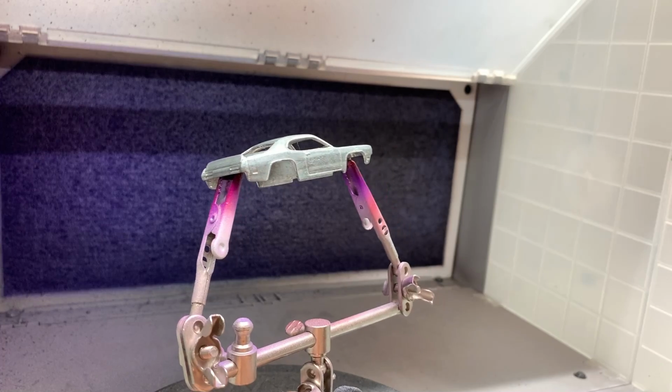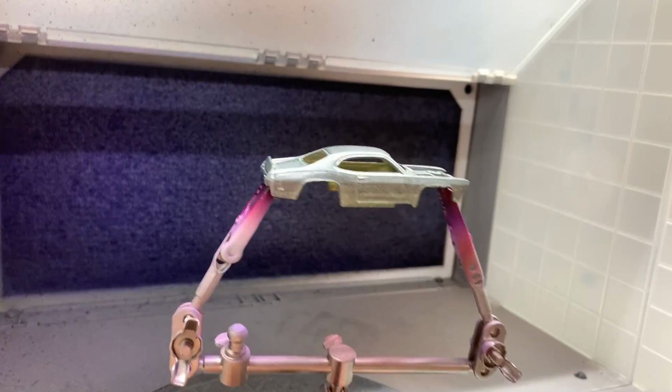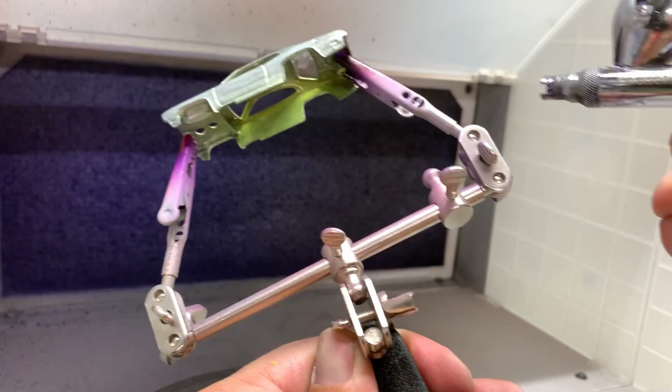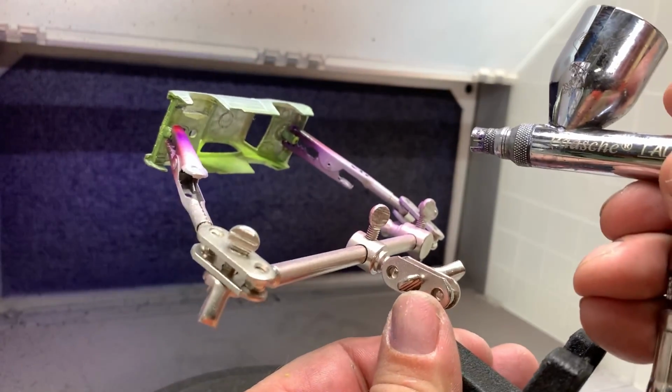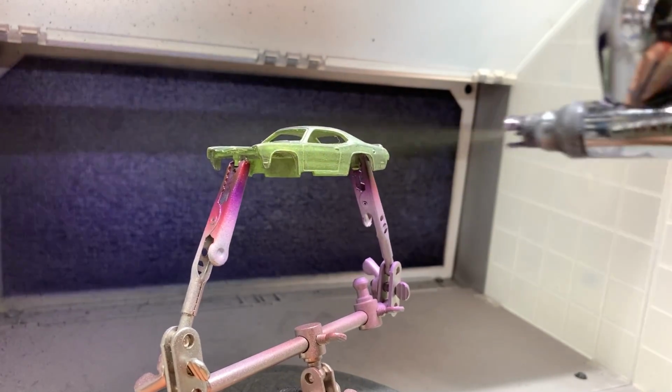We got it out of the Citrus Strip, we scrubbed it down, and we also sprayed it down with degreaser, and we scrubbed that down. Make sure you scrub it with degreaser, because if you don't, your paint might not adhere to the surface that you're spraying. Here we're using this Competition Green from the Redline shop.